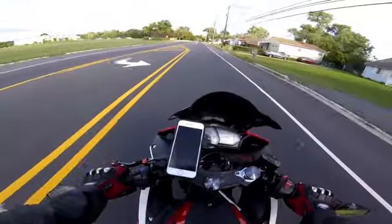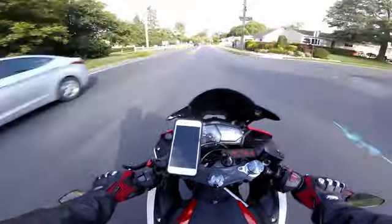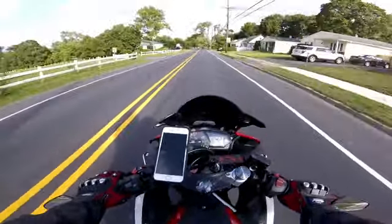If there's anything I've forgotten, it's that when you're hitting your brakes, you're going to want to hit them a little bit softer than you normally would, and then apply them harder over a longer duration of time, because that extra weight on the rear of your motorcycle drags you a little bit farther. You don't want to apply them abruptly, because it's easier to mess up that way. If you slowly apply them and then gradually increase the force of grip, you'll eventually slow down and come to a complete stop safely.